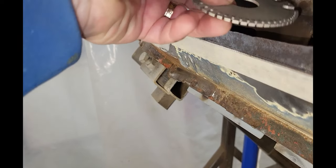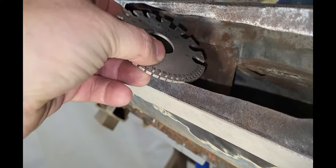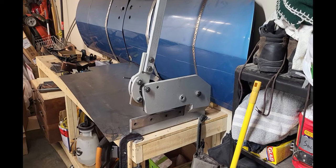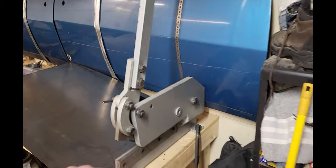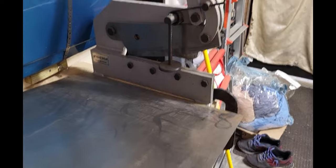One thing that really surprises me is how thin this metal is. I'm going to put the feeler gauge on it — it's down to like 20 to 23 gauge. That's pretty thin. I might cut this out some more and see if there's thicker metal to be had. I'll go ahead and cut my patch piece — I've got some 18 gauge here. I've got this metal shear that I picked up off Kijiji last year. It seems to be in pretty good shape; got a good deal on it. It should be perfect for cutting little pieces of 18 gauge.